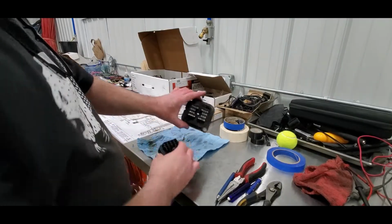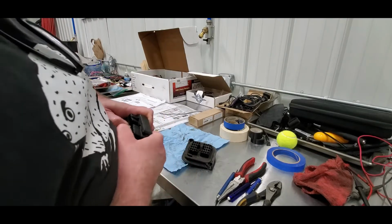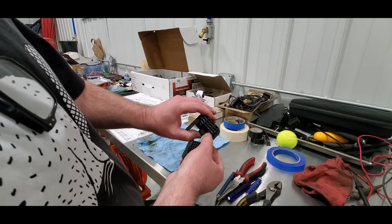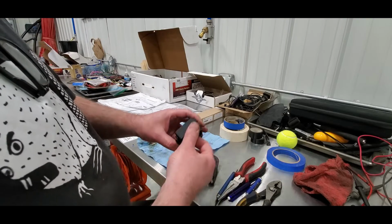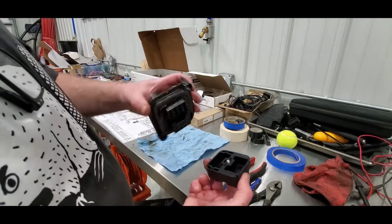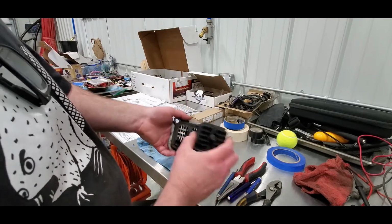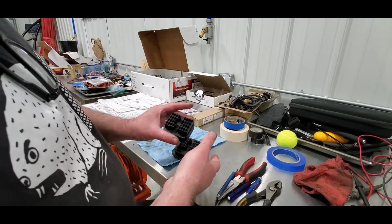All right, so pretending that this is the one that's in the car, the way these go together is, you gotta pop that apart a little bit. You have a light harness and an engine harness, and you can tell which one's the engine harness because it has the large 59 series for the power in. So the light harness plugs into it, you pop them together, and then you go, oh, it doesn't fit. It's because it's keyed. So you can't even screw that up. So that'll go in, that bolt gets tightened in, draws it, and that's it. It's really nice because that means that these two harnesses can be broke apart and built separately.